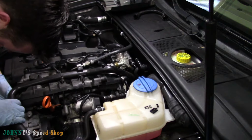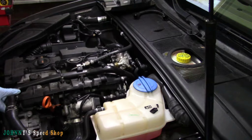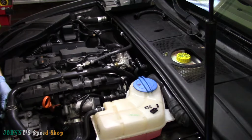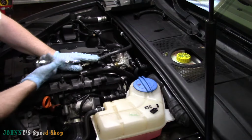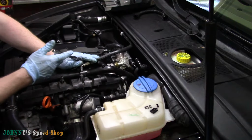And this front bolt's gonna be tough, but I would put that one in first if you can. Yeah, there we go. You grab a little 1/4 inch ratchet. I don't want to be going in there with that little air tool, and next thing you know, you crack the intake, and then it's just a day ruiner. I'll do the same up here. You go after that with an air ratchet, you might get carried away, and now you're buying an intake at that point.